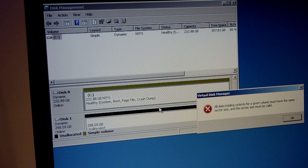That's really weird — it seems like with Windows 7 mirroring you can't use two different drives. The one time I did use RAID I created a RAID 0 array using a Seagate Barracuda 80 gigabyte and a Western Digital 120 gigabyte drive, and it took the specs of the lowest drive. I'm not sure what's going on here — I've never used the Windows 7 disk management mirroring option before, so I'm going to do some more research.